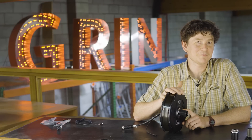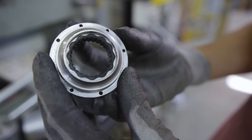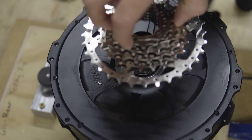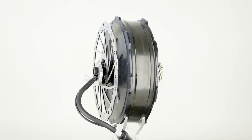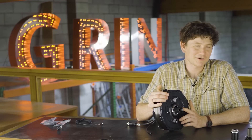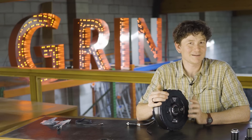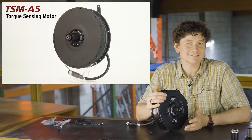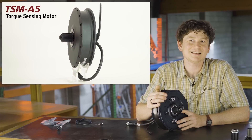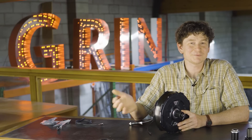So let's talk about the rear motor hardware. This has a Shimano HG industry standard cassette freehub body on it that's compatible with all the 8 to 11 speed drivetrains found in most mountain bikes. One question surely on the tip of everyone's tongue is whether or not this freehub body can sense torque and have a built-in torque sensor. Given that Grin released a motor last year with built-in torque sensing cassette, you would think that our all-axle motor would also feature that — and trust me, we tried.